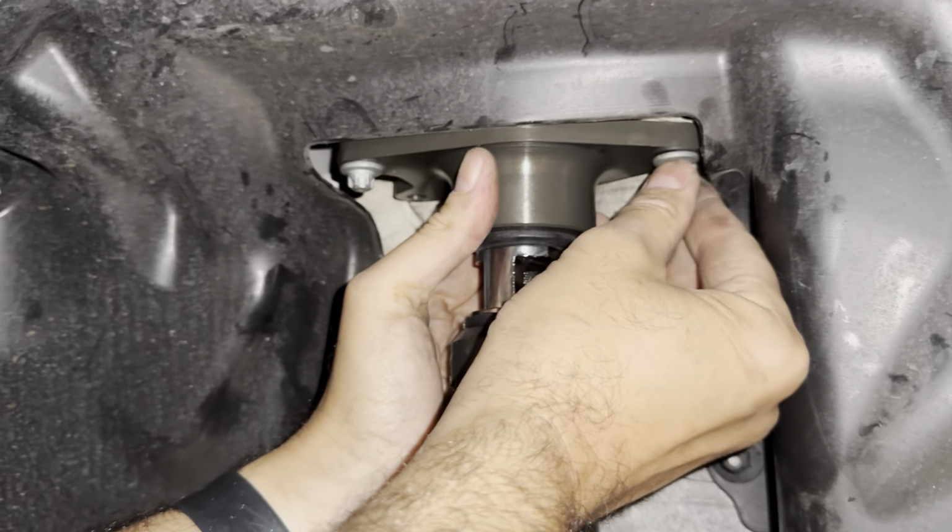I did have the car corner balanced. The guys here at Action Tires and More run cup cars themselves, very experienced drivers, and they set up the car corner balanced. It looks like it's nose up, but I think it's just because it's a 35 series tire in the back. But it felt really good. Touch of understeer in some spots, but I can tap the brakes, settle the car, bring the nose back down. I might play with that a little bit and just drop the front by like 5 mil. That'll give me a little bit more weight on the front tires. But I could go do another track day right now and it's set up perfectly, so I don't really want to mess with it too much.